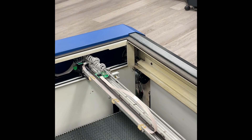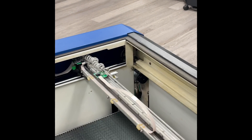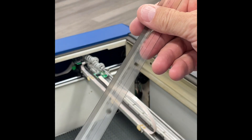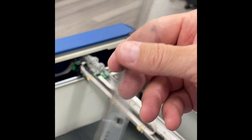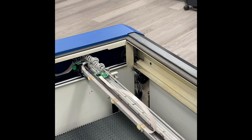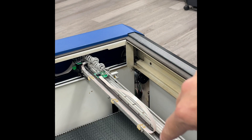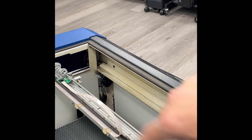As mentioned, the most common problem is simply cleaning the linear encoder strip. This linear encoder strip needs to be either cleaned or replaced — only with some clean water and liquid detergent diluted, cleaned with a soft q-tip or rag, to make sure we're not damaging the encoder marks on the strip. This strip is actually held in place by some screws and a long x-axis guide rail and an aluminum bar or rail along the full x-axis.